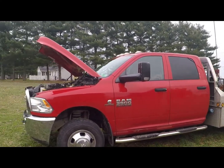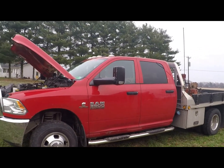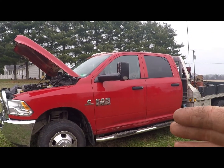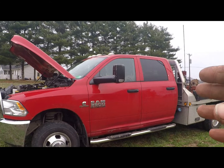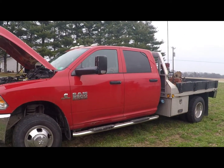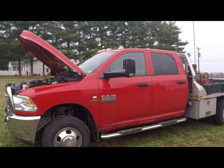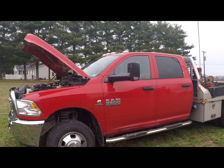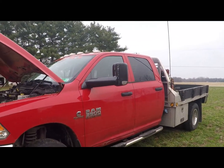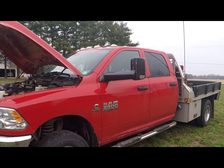He changes shift points and all kinds of stuff. But I heard the Aisin is a self-learning transmission. They say the Allisons are self-learning, and I noticed when I first was running it, it seemed to shift kind of funny, and it's smoothed out now. A lot of people I was reading about, when they get the switch to change on the fly, their transmission can never learn because they're always changing the tunes. So I just wanted simple. I wanted the truck to breathe easy and be more dependable. So that's what we went with.